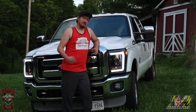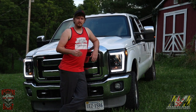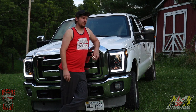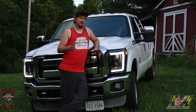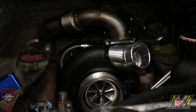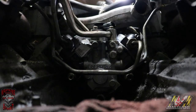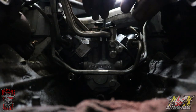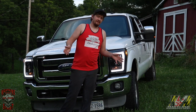Hell yeah. So it's been a minute since we talked about our tow rig, a 2011 6.7 Powerstroke F250. Last video, we left you off as we were about to put a Maryland Performance Diesel budget turbo kit on it, with a 66 millimeter turbo, a 10 millimeter CP4 stroker pump, and a piping kit, you know, the whole nine. And we did it. So let's talk about it.